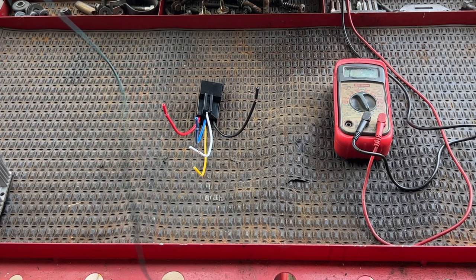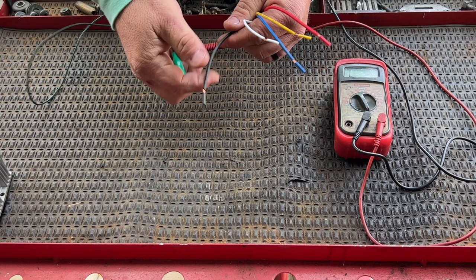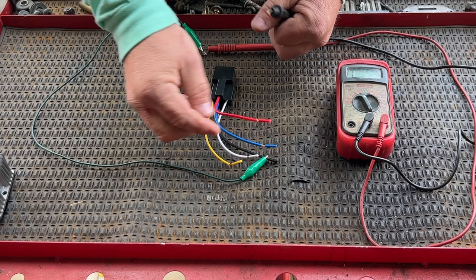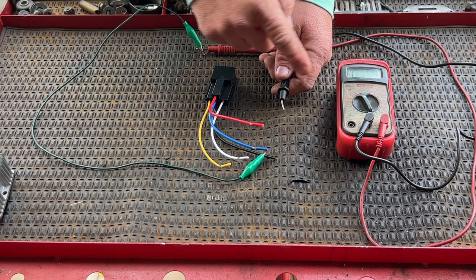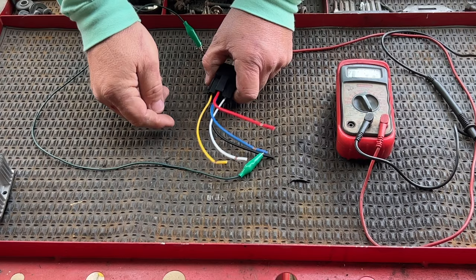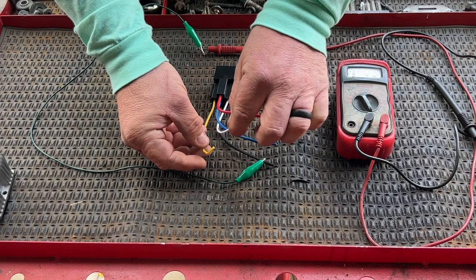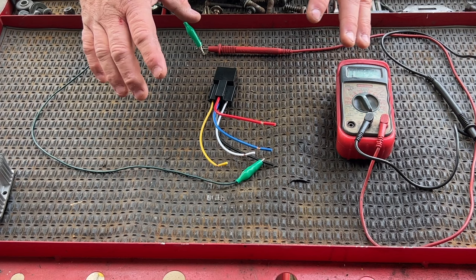The battery is now dead so we'll move the DC converter out of the way for this demonstration. I'll place an alligator clip on the red lead of my multimeter. When we touch the red lead to the red wire, there's no continuity because there's nothing going through the coil. But if I touch the black lead to the blue lead, you're going to hear a beep because we have continuity between pin 30 and pin 87a. That lets us know those two pins have continuity when there's no power going through the coil.